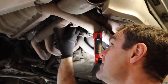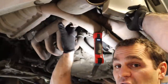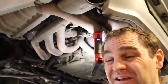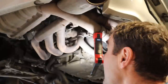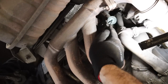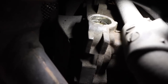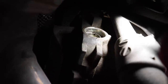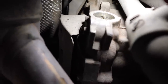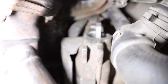If you're facing the flywheel, this is the back right-hand bank of the engine near the exhaust, and you can see the cover I need to remove to lock the cam. Once you have the crank locked, you only actually need to lock one of the two cams - once you've locked one, they're both locked. You can see there's a slot in the end of the cam, and you want to make sure that's facing up and down nicely so you can get the locking tool in and lock it into place. You can use one of the pressure plate bolts to hold it in place.